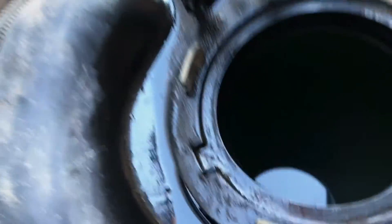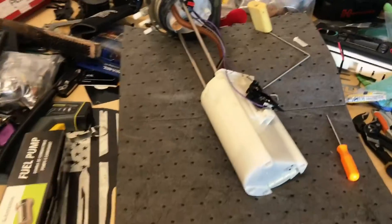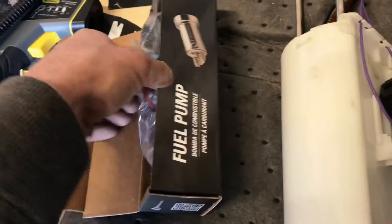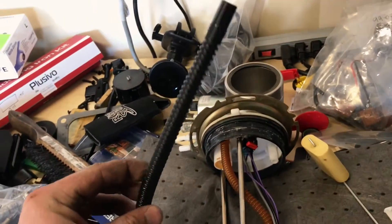I might have enough, but I'm looking for a way to splice it. Anyway, we'll go over the fuel pump - you can figure on about a 10-gauge wire back here. Here is the stock sending unit, 99-03 return style. This is the Walbro 525 - I believe it's the Hellcat one. I bought this and it looks like I got the right length, pretty damn close. This is a 10-mil on each end, I think 300 millimeters long.